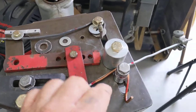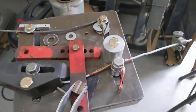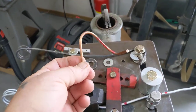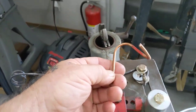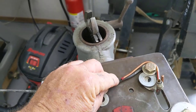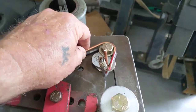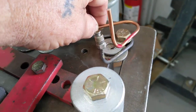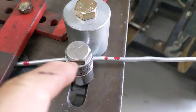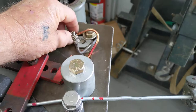I've got this block so we don't have any movement here — this is the old line pinned down so I've got good measurements. I tried to put this in the bead roller but it was too tight. This here is just good old number eight copper grounding wire — that's what I've always used. I've got plenty of it and it's almost exactly three-sixteenths to the tee, so that lets me measure. Red dot, red dot — and now since it's hitting the nut here this is not short. It's going to be just right, and that lets me gauge this as I roll around the bend. I'm fixing to put some oil on here, roll this bend, turn it, and do the turn-up.